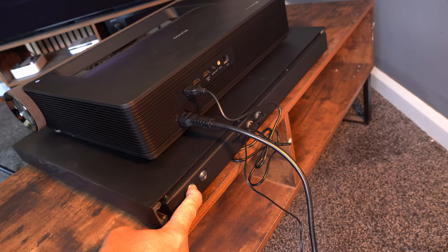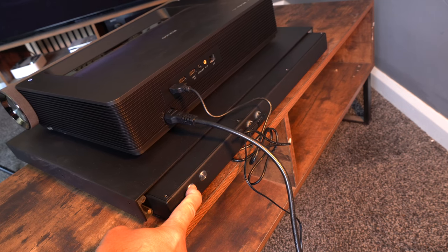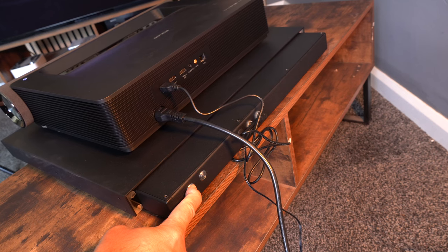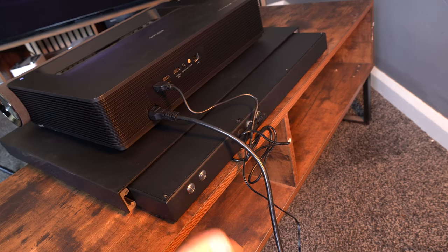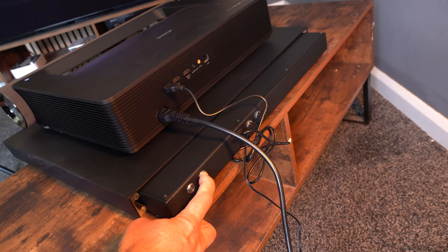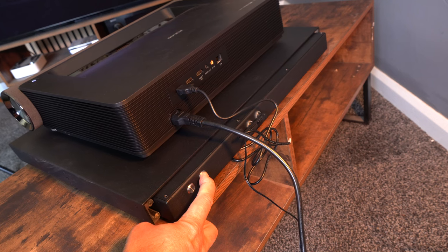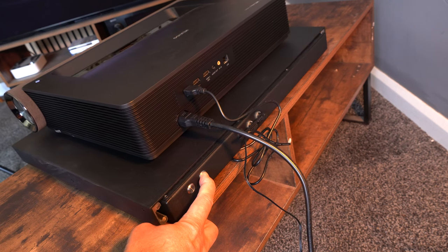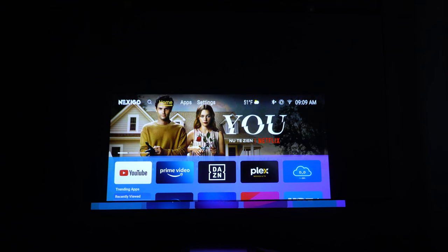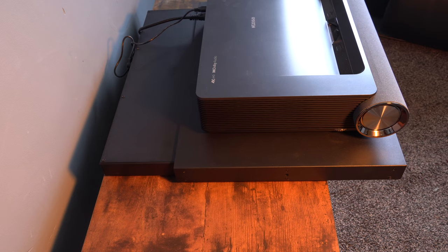The two buttons nearest the bottom of the screen — one is for extending and the other is for retracting. All you do is extend to the correct distance away so that your screen is set correctly, hold it there for 30 seconds, and then it will remember it. Then just bring it back to wherever you want it, and again it will remember it after it's been there for 30 seconds. Every time you turn your projector on and off, it will automatically go to that place.